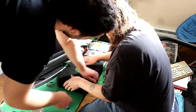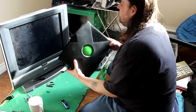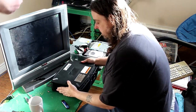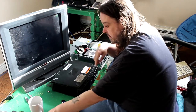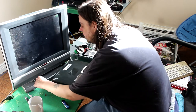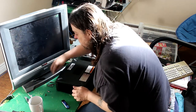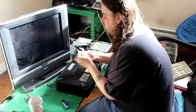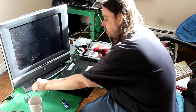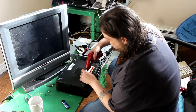Yeah. Okay. And then just very carefully flip it over so it doesn't come off again in any way. Remember the trick I showed you with the screwdriver? Oh, yeah. Basically turn it backwards until it clicks and then forward. Otherwise, it'll make new threads. It's an easy way basically to avoid cross-threading the screws in situations of any kind. So, I guess that one first.